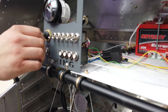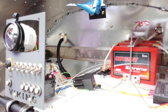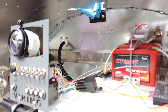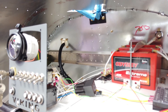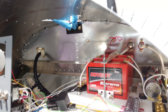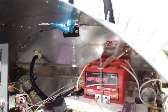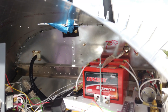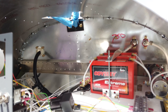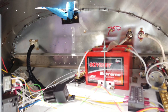Key — the key only cranks the engine. Number one: throttle to idle. Undo the friction lock and pull it back gently all the way back, lock the friction slightly. Battery one, battery two — two batteries. Fuel pump one, fuel pump two. Then crank — clear the area. Just crank it until it starts and let go.